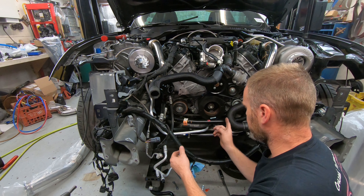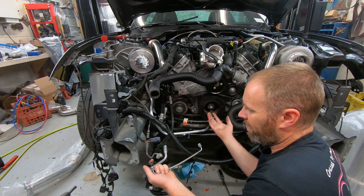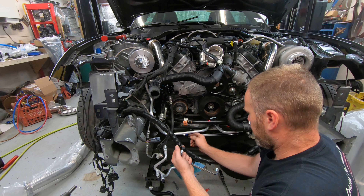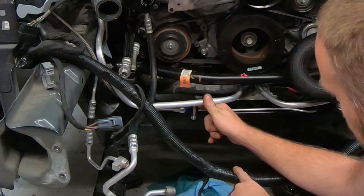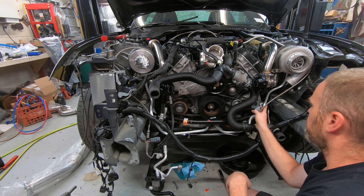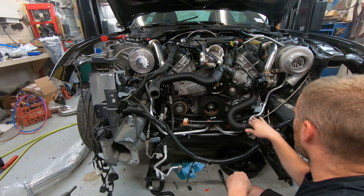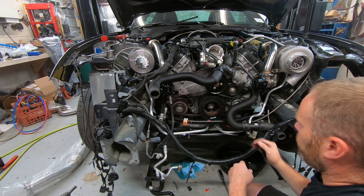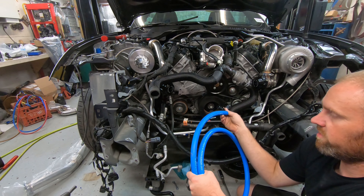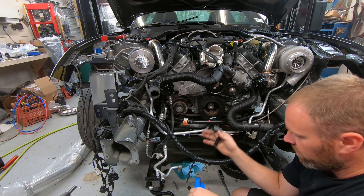Instead, what I've done is used two fittings — I grabbed another fitting I had and put it in the oil filter adapter, which comes with three different holes. I ran this line to a line I made out of soft aluminum — a hard line — and hooked it up here with a fitting to hold on to it. Then I ran this one to extend it to the oil cooler housing, and ran the other one directly to the housing since it had plenty of length. By doing that, I kept the lines out of the way and clear of any belts — so if you reach your hand down there, you're not hitting a bunch of crap.